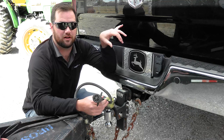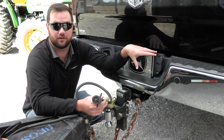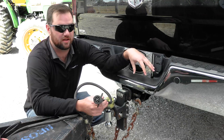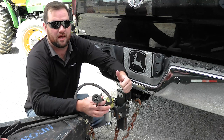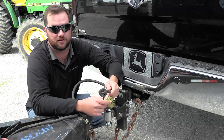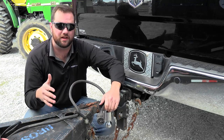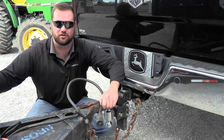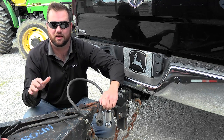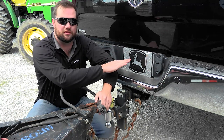You're going to lose energy from the alternator, so you're not going to get that 13.2 or 13.3 volts coming back here because the wire gauge is so small that you do lose some of that voltage by the time you get back here. So just keep in mind you're not getting the same charge rate as your vehicle battery gets when charging the onboard battery — it's going to be much less, which is why it's not a very efficient way to maintain your battery. You're also going to have to drive for a very long time to replenish that energy, even if you just dump once or twice, because the dump trailer uses power much faster than your truck can charge it.